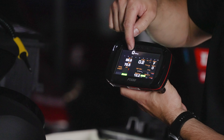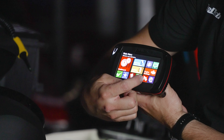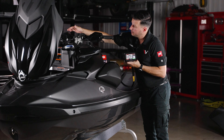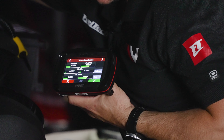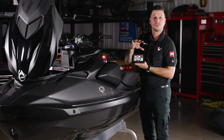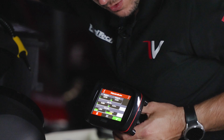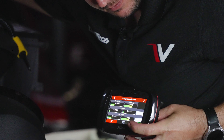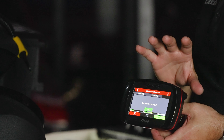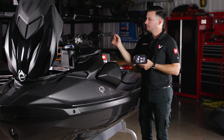When you touch the RPM bar at the top, you'll access the main menu. Go to Sensors and Calibration, then select TPS pedal calibration. Click there and you'll set the sensor that tells the ECU when you are at zero and 100% throttle opening. It's best to do this before starting. Without touching the accelerator, click Calibrate, then go to 100% and click Calibrate again, then click OK. The ECU will perform the throttle body calibration for your specific module. Once it says successfully calibrated, click OK, go back to the main menu, and now you are ready to fire up.